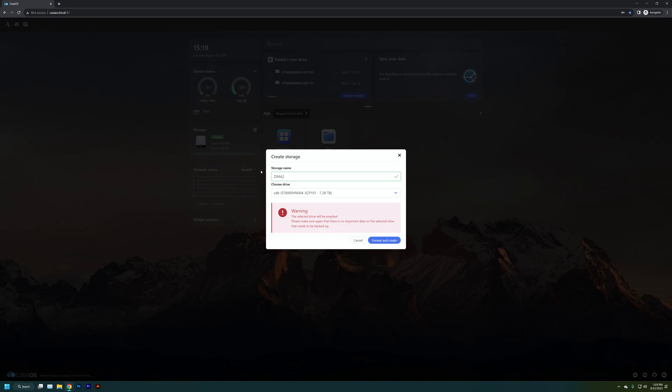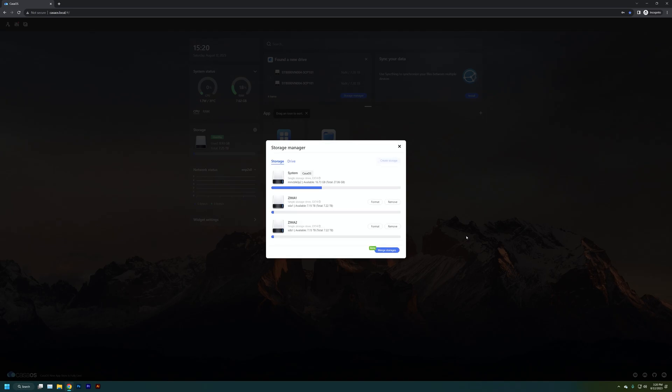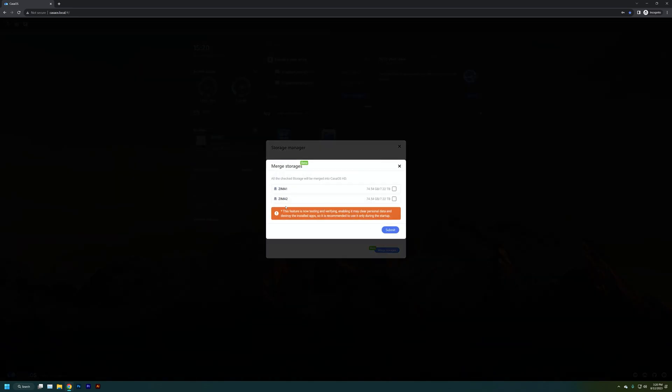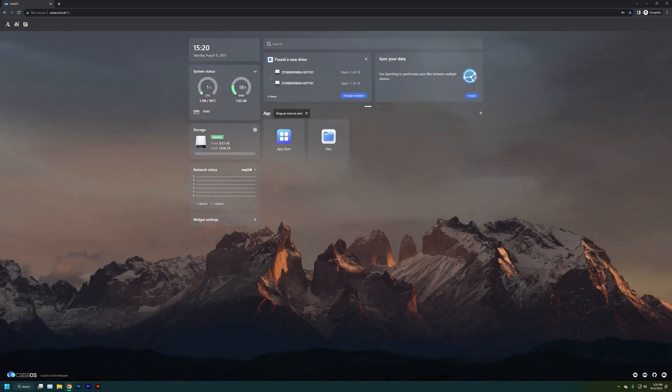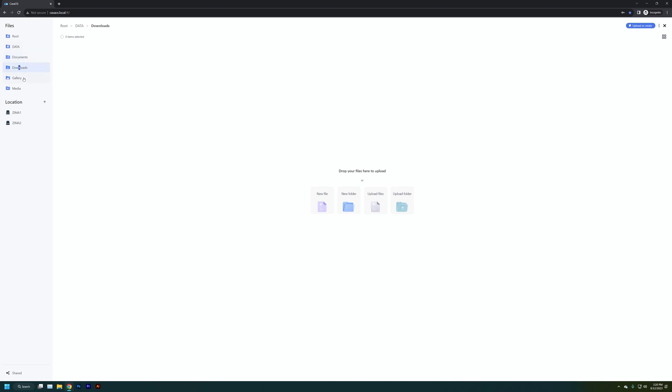At the end of the day we'll have about 15 terabytes usable — the 8TB drives have around 7.2TB of actual raw capacity each. There's a beta feature in CasaOS that lets you merge these drives into a single virtual disk, but I'm going to keep them separate. There's no RAID functionality in CasaOS like you'd have with TrueNAS or Unraid, so instead we'll write everything to one drive and then mirror it to the second drive, either using Duplicati for backup or just copying and pasting.